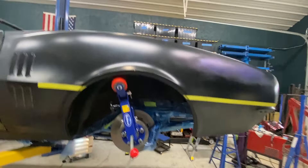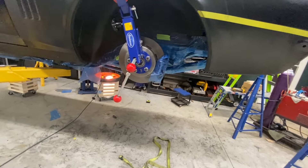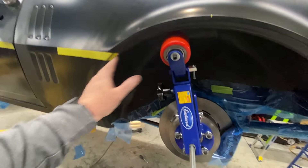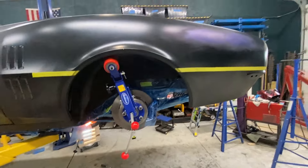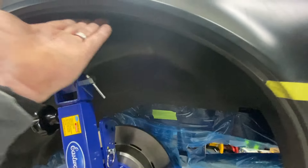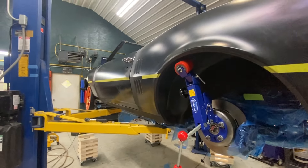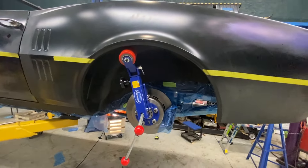Not impressed at all. What's happening is even though my axle is perfectly centered in the fender well — which I checked — and my axle is where it's supposed to be wheelbase-wise — which I also checked — this is not obviously a perfect arch. So I'm not touching here because it kind of goes up higher in the front and then fades out a little further in the back, sharper in the front. Honestly, this is just not working all that great. It rolled it up a little bit from here to here — it actually looks pretty good — but I'm struggling to get this thing to work. It's not really doing what I expected. I'm way better off with a hammer and dolly trying to do this. That's an epic fail, at least for the Camaro fender wells.